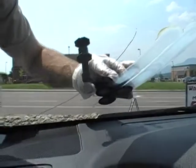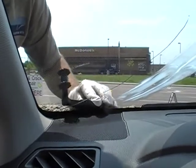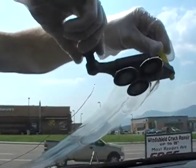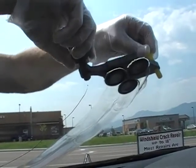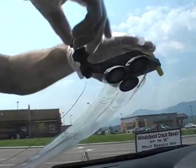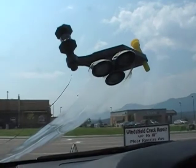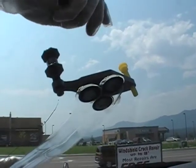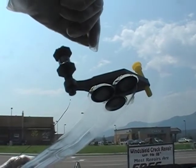We're going to suck it down and keep it right over the crack. Then turn the injector and the adjusting bolt down until it touches the glass and then just a little more. On cracks, we don't need a lot of pressure — maybe about a turn or so. We just need enough pressure to get a seal onto the crack. Pre-grease your track, have everything backed off as you suck down the tool, and then adjust to where you've got enough pressure to keep a seal on there.